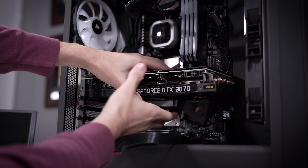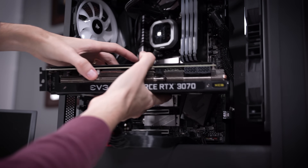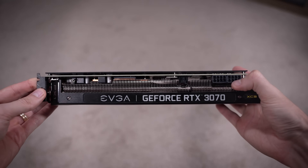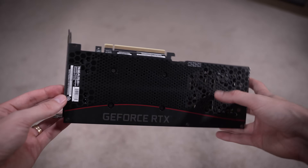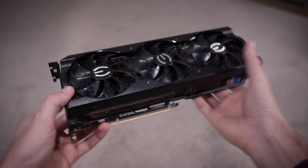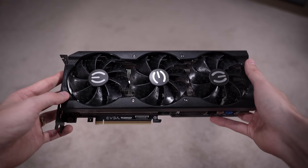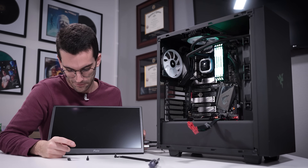Out she comes — two cables disconnected, screws removed at the rear. We'll do a quick physical inspection: I don't see any burn marks around the gold fingers at the base of the card, and the two 8-pins look pretty clean. We can't see much else because of the backplate and cooling shroud, but all of his ports look okay. The card wasn't spinning fans or anything when we were attempting to power the system on. Removing the card to rule it out — and it powered on right away.